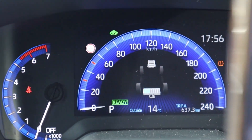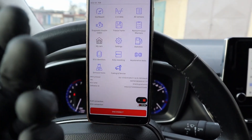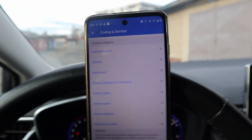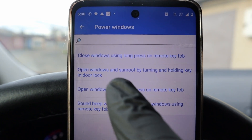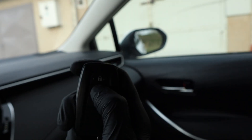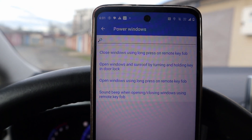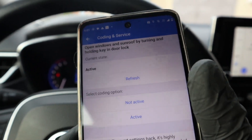And as you can see, no more check engine light. Another amazing feature of this app is unlocking hidden features. For example, let me go to coding and service. Now I have these categories of changes I could make. For example, if I go to power windows, you can enable closing and opening windows with your key fob — if you press it like this, the windows could go down. I was pressing but nothing was happening because my car didn't know this. But if I go in the app and set it to active, now my key fob will be able to open and close my windows.